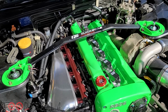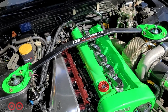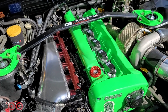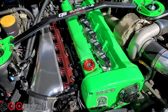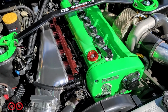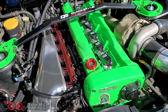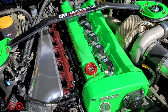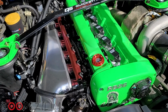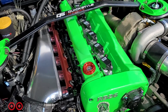So I've got CP pistons. They are 86.5 millimeters and 8.5 to 1 compression. I have a bigger wrist pin upgrade as well. Manley Turbo Tuff I-beam rods, ACL race rod bearings and main bearings. The valve seals are SuperTech. I had SuperTech bronze valve guides installed.